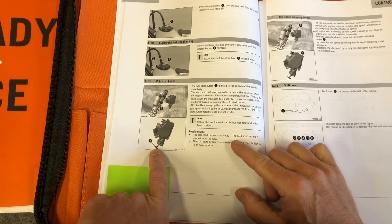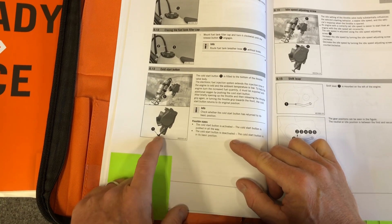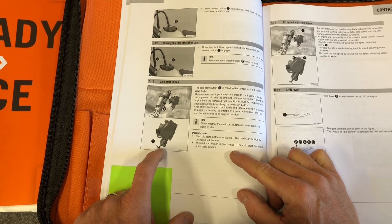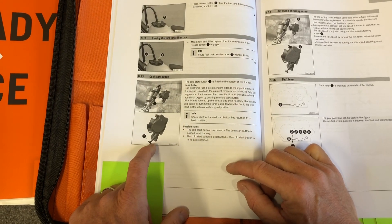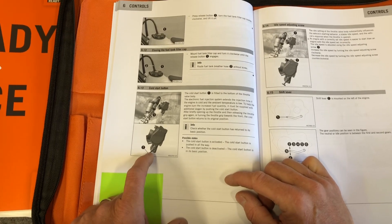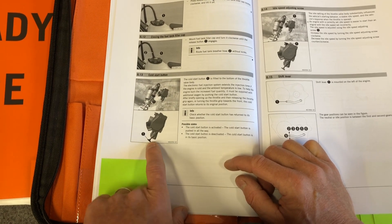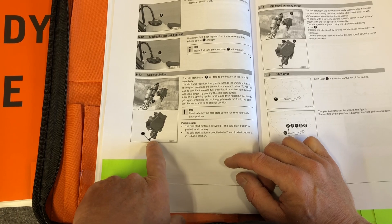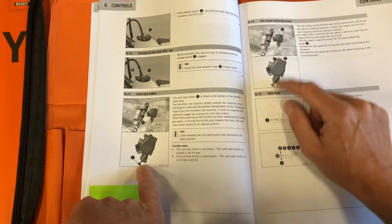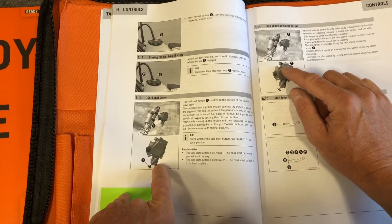The bottom is the yellow knob — that's the cold start knob. On this setup you push it in, unlike a lot of motorcycles where you pull it out. The fast idle speed knob gets pushed in. When you want to release that, you can either pull that knob out, click it out, or you can move the throttle grip backwards — that will release the little detent. That's the fast idle, and it's adjustable. The red knob at the top is for the standard engine idle. Both of these have adjustment points, and you should experiment to see what each one does.